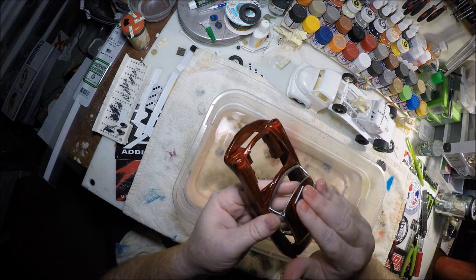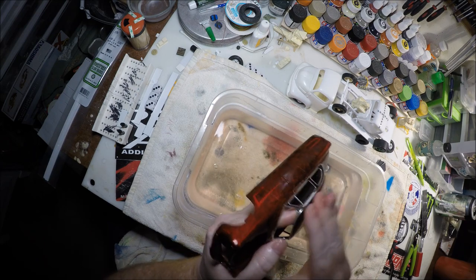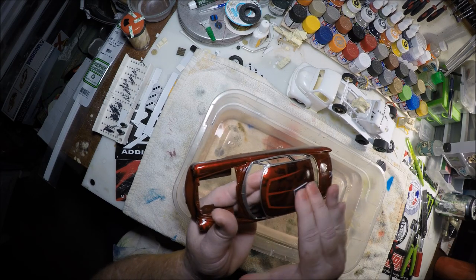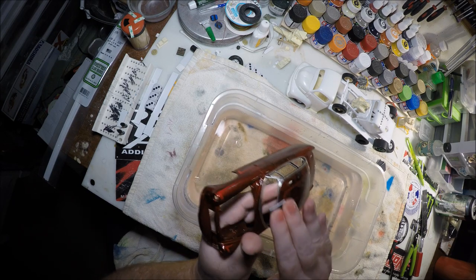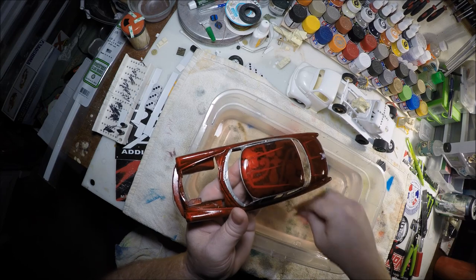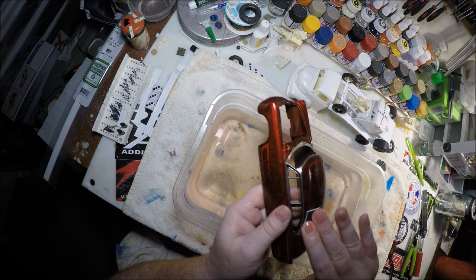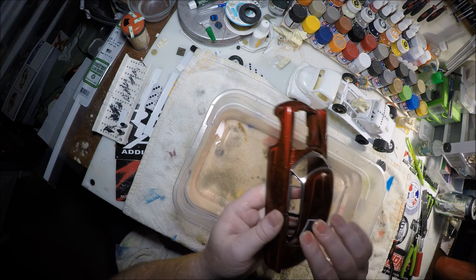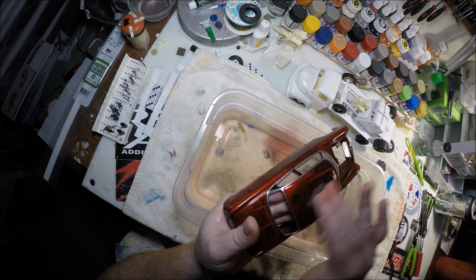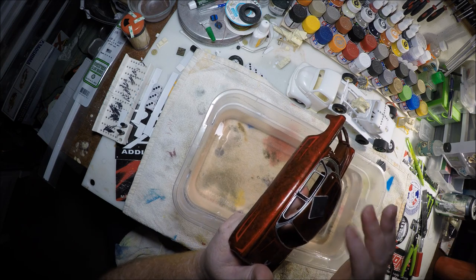I just want to dip my paper in and try to stay as flat on the car as I can. I realize cars have curves and you're not going to be completely flat all the time, but as long as you can get it to hug that curve, it'll sand it down to where it's completely smooth — which is what we're trying to do to create that mirror shine. I don't want to get too close to the edges because with 1500 grit it'll burn through really quick. I'm just trying to get a good smooth surface because I'm going to put a couple more coats of clear on.